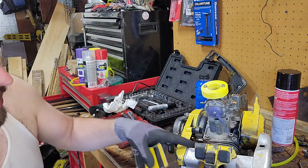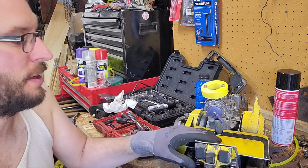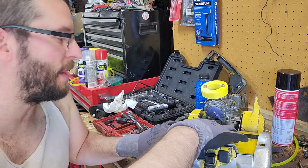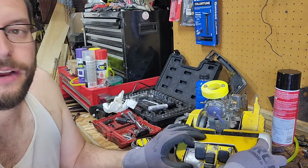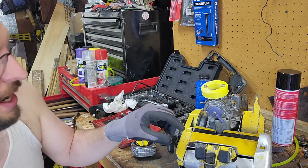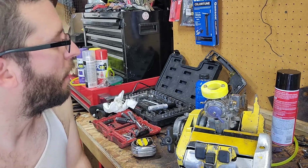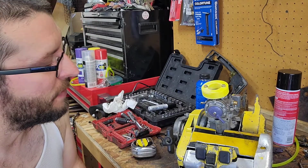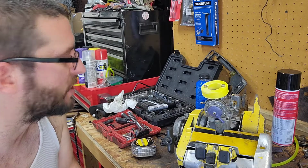But designed so that you can still utilize the rear shroud, obviously. Always gotta pull the trigger. I gotta put a screw hole in, but made so it'll bolt down, hold the intake down, you can bolt over here, there, the whole shebang. And then hold this rear, so it'll all be solid. I gotta measure, drill holes for this, bolt it, all that good stuff, and then when this one's set, of course, I still got to make throttle linkage, which shouldn't be too difficult. That's actually a pretty simple process.